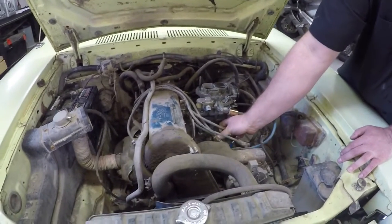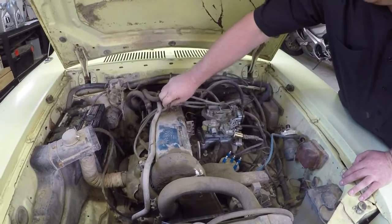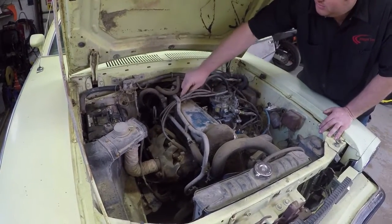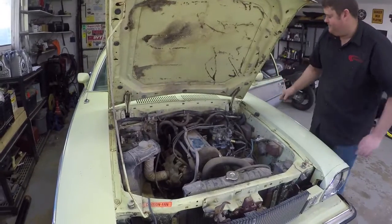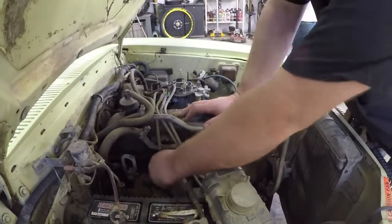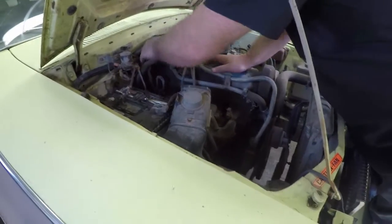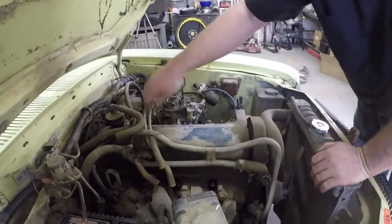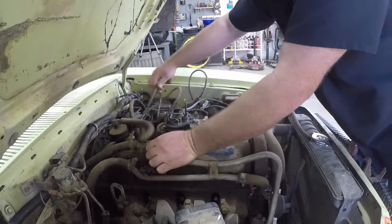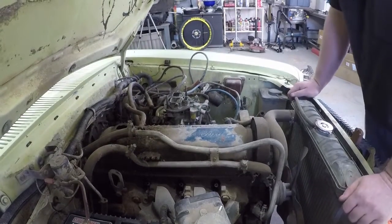They confirm they have spark plugs - TR6s were considered but those are a modular Ford supercharged application plug. For a naturally aspirated car, especially just to make sure the bottom isn't going to blow up, you want stock heat range. The car actually rolled off the trailer and drove into the shop on just the float bowl, without the choke even hooked up - almost the same as a full road test.